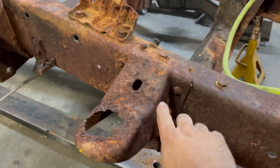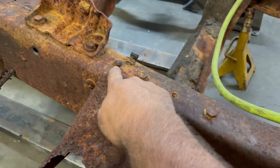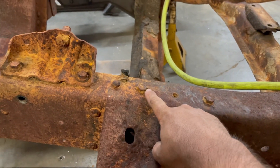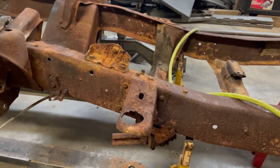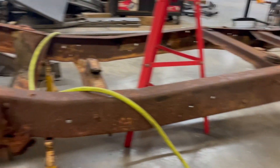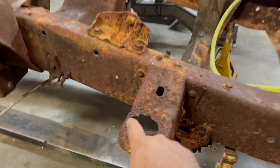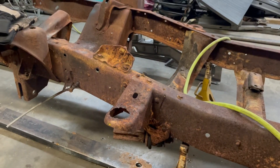Now that we've got all the tools acquired, let's get this job started. To start with, there are a few rivets you've got to remove to hold the cab mount on — one here, one here, a rivet here, and two rivets on this side, then you'll have this one bolt here. You don't have to remove your cab to do this; we just happen to have a bare chassis here already, which is pretty rusted out.